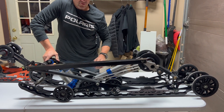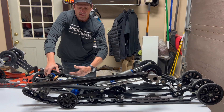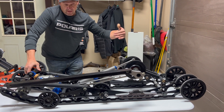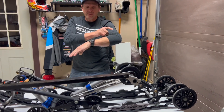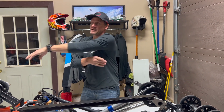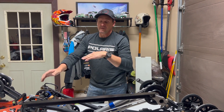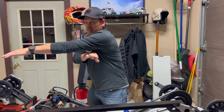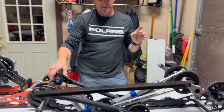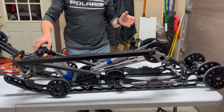When you hit that bump it starts using not only this spring but the two springs here, and what it's doing is picking this arm up and pulling that down - kind of angling that rear suspension. So when it's hitting that bump the rear isn't hanging out there to get hit again. In the old days you'd hit it here and then hit it here again; now it's already pulling that rear up and angling to miss or go over the next bump. That's where that coupling comes in - everybody talks about it - the front arm hit is coupling and using that rear.